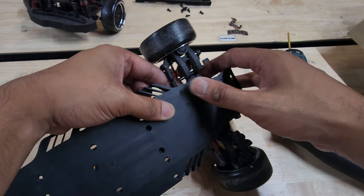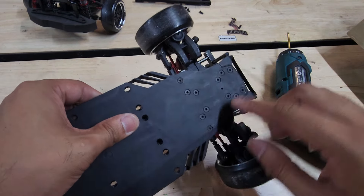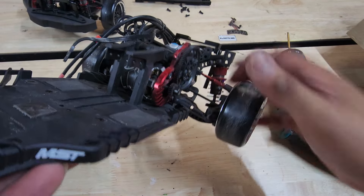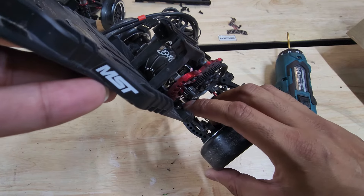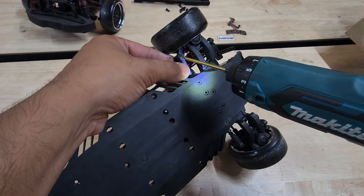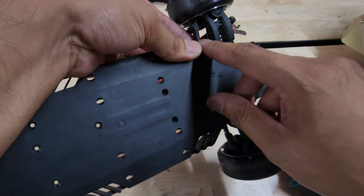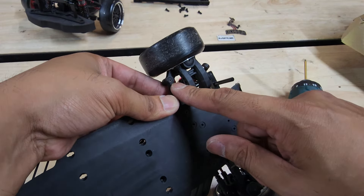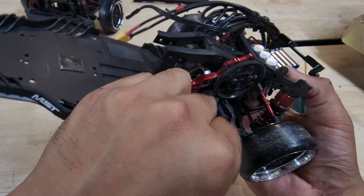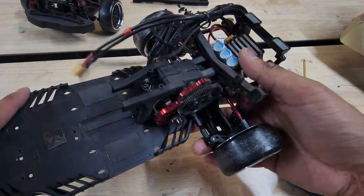This one's got the MB arms upgrade, and if you don't have that then you won't have this screw. Because I've installed the MB arms, it's got a ball there that I've got to hold still. The best way to do this is to take off this part on the knuckle before we can take that screw out — then that'll be all empty there for us to hold with pliers or a spanner.